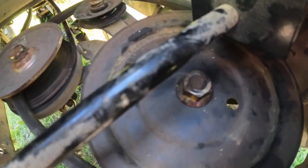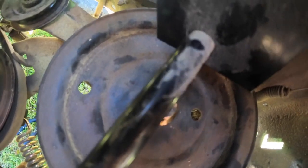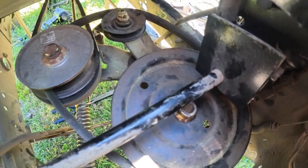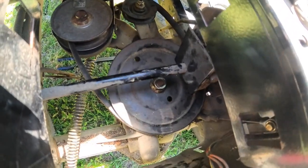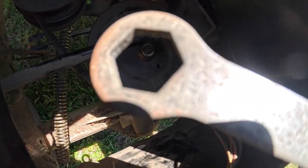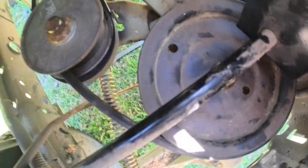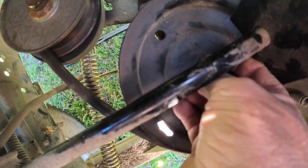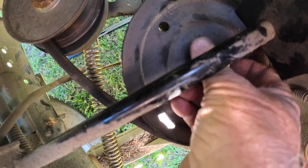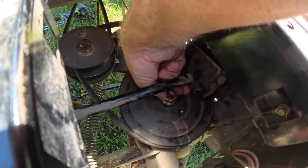So what you have to do is take this pulley off. And of course, you see where they located it. You can't get an impact gun or your socket, just a ratchet wrench on there. So what I did, on this one at least, that's a 22 millimeter nut that's on there. This is a 22 millimeter out of a toolkit for a Yamaha. But you just take and loosen that up with your 22 millimeter. There we go. Take that off.